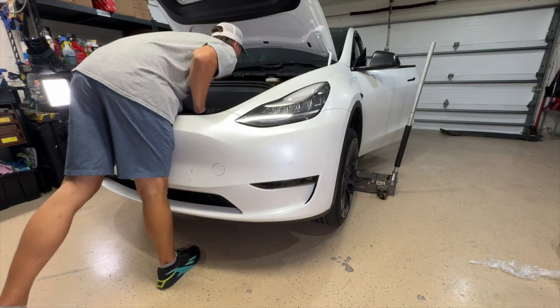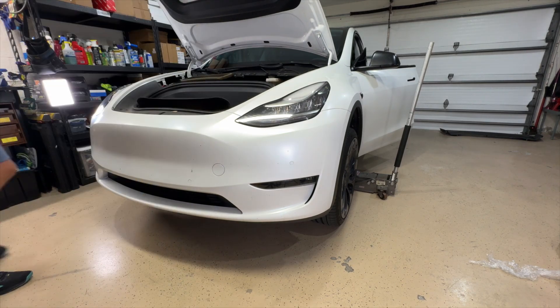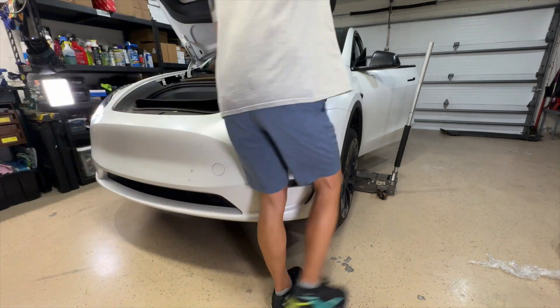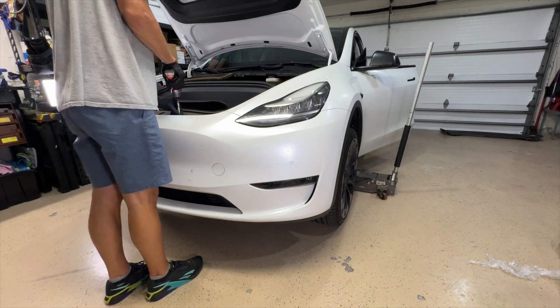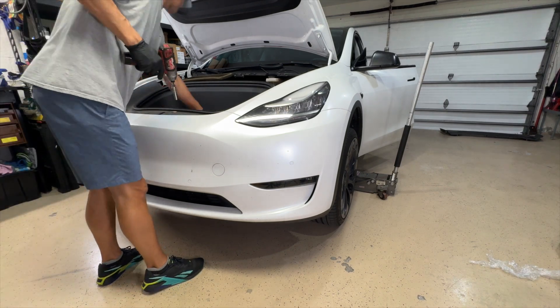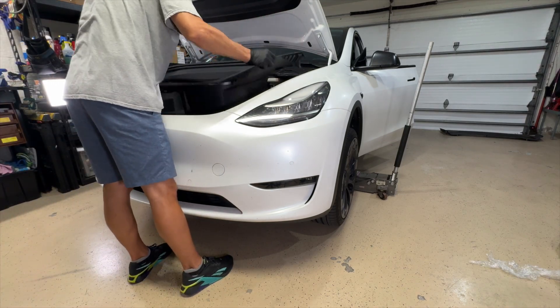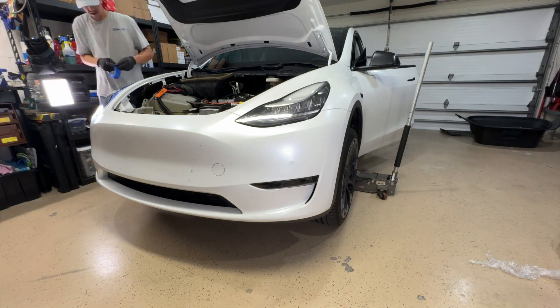The first thing you're going to do is remove that top tray and get that out of the way. Then there was this little insert — I'm just going to get my 10 millimeter and remove the two down inside and then the two right there in the front. There's a little plastic clip that I just took out, and then remove the wiring that goes to the emergency frunk release.